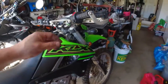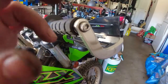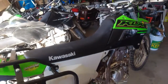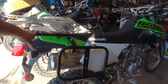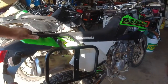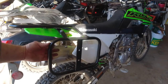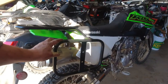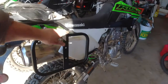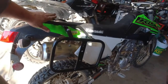Bit of a hard install on the KLX, just an FYI. There are welded bungs in here and they're not threaded, so I had to drill them out and thread them for M8 1.25. We've got a whole video on this, but these are dirt racks from dirtracks.ca — it's a Canadian company. What a good piece of kit. They're not the cleanest bends — the pipe does narrow a tiny bit in that tight 90 degree — and the welds are obviously hand welded, but the powder coat is nice, like a wrinkle finish.